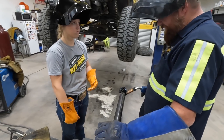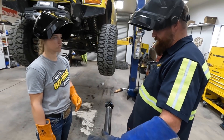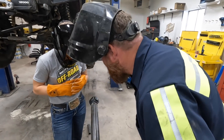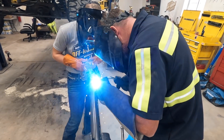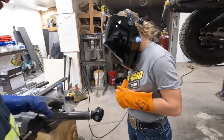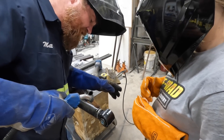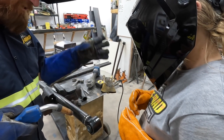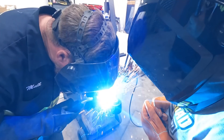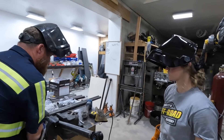I'm just trying to get this piece of metal and this piece of metal to be the same piece of metal. I don't even care about these tacks - I'm going to burn right across them. I'm not looking for a pretty bead, I'm looking for a strong bead. There's quite a wide groove - you want to fill all the way up. When I start welding I'm going to drag back onto this before I start coming so I connect this weld to the previous one, then go plenty far past.